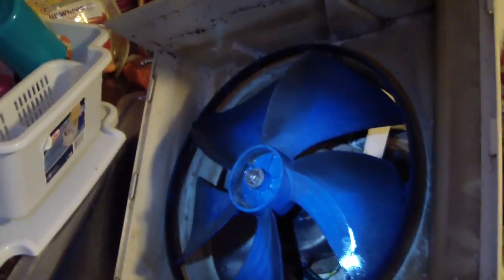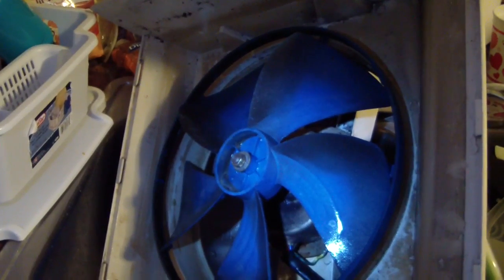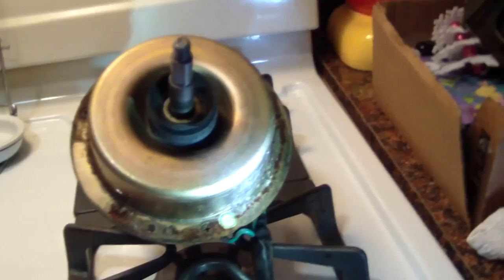Here's what you have once you've pulled the motor assembly out — the blower assembly — and you pull the wheel off. Then you come out here and start washing it, because it's pretty disgusting. That's before you break that nut off. You're gonna want to use a crescent wrench on the other end — it's probably on there pretty tight. And here's what it looks like once you have it removed.